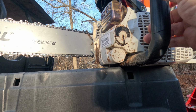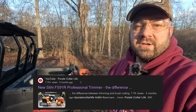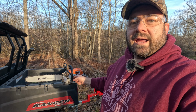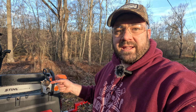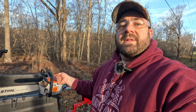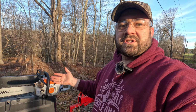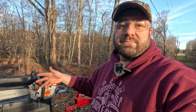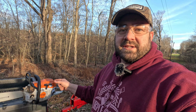And I mentioned in a video where I talked about getting the new trimmer, a professional grade trimmer, I gave the update on what happened when I took this saw to the dealership. They found actually that one of the oil line hoses wasn't on completely in assembly from Stihl brand new. They fixed that. It took about 2 months for it to stop leaking in the garage. I think there was still just some oil laying within the case that kept dripping out in the garage. But since that time, I get normal amounts of oil when this thing sits.